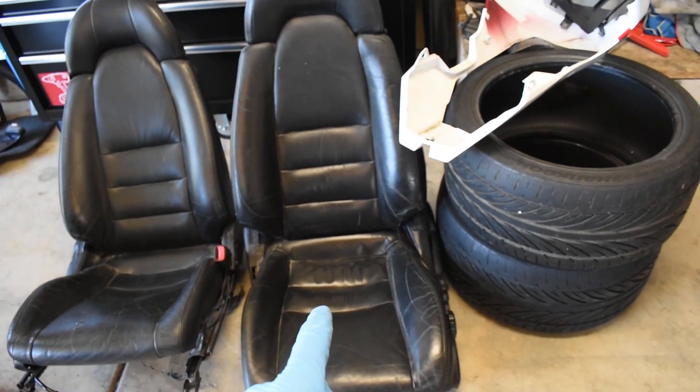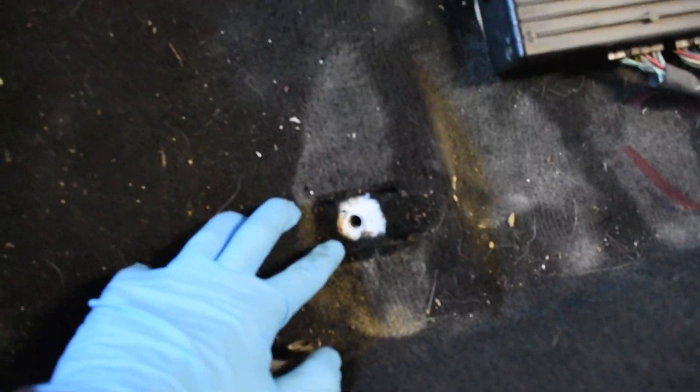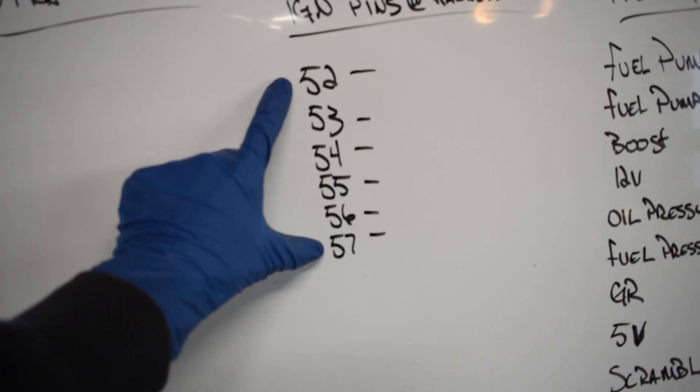The driver's seat was a little more difficult because I couldn't slide it since I don't have power to it. Underneath the seat is actually a factory amp. These are the mounting spots — there there there there and there's one right over here. The bracket went to both spots. I'm going to go pop the pins out. I loaded up my laptop because I have all the pictures saved with the proper pinouts. With the ignition coil wiring, pinouts 52 through 57 are for the ignition coils — one through six respectively. My laptop died so I'll let it charge. In the meantime, I can wire up my IAC at least.